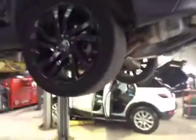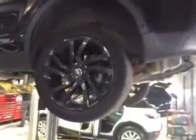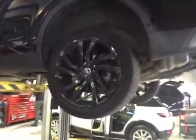Coming around to your near side rear tire, you've got 5.8mm of tread on this tire. You do actually have a puncture on the edge of your tire — it actually extends onto the side wall, so it cannot be repaired. I'll write that up on your vehicle health check. All trims and mouldings on this side of the vehicle are in good condition.